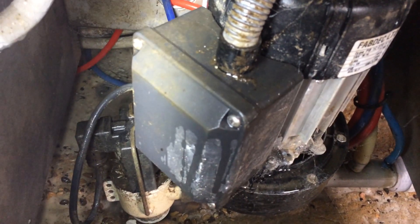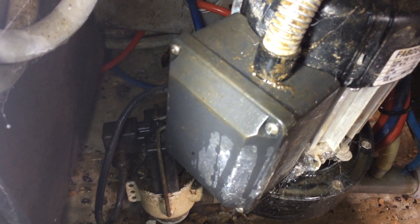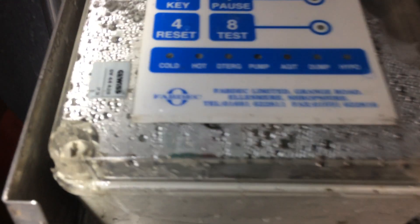The dump valve's wet. The motor's wet. My money would be on the motor. It might just be the terminal box if we're lucky — that connection isn't really waterproof. Hopefully the water's got inside that box because it's got condensation in these two, so we'll have to dry them out. That's pretty bad.